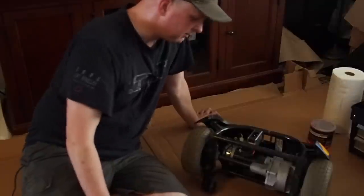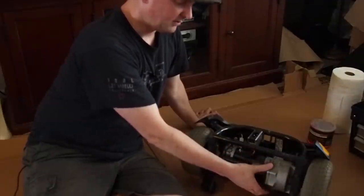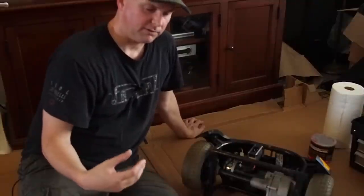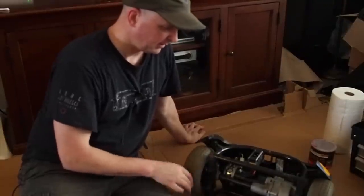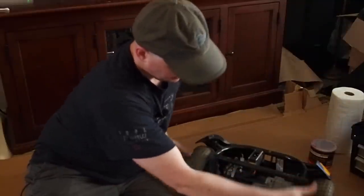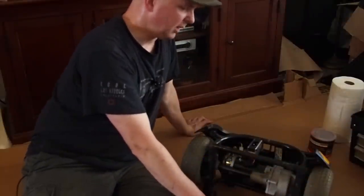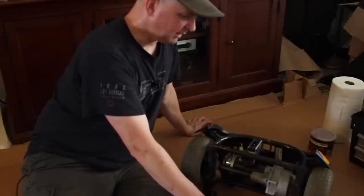In doing this I have no idea whether or not I'm going to achieve my goal, which is to rebuild this transaxle. I rebuilt it a month ago and I think I built the whole thing too tightly — when it is slowing down or in reverse you hear a terrible grinding sound. I think it's built properly otherwise, as you can see the wheels turn in opposite directions. If they go the other direction it's fine, but this direction you can hear the noise, and that back pressure is what I'm trying to get rid of.